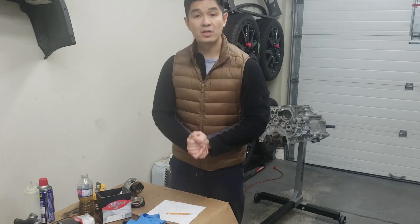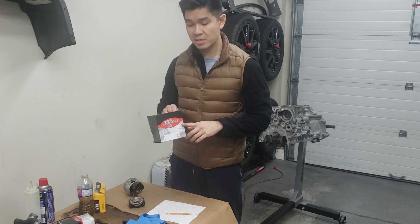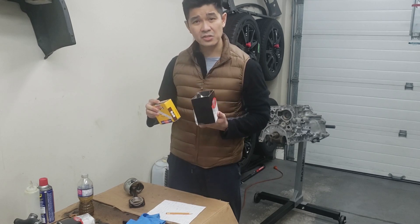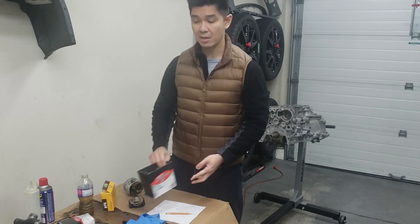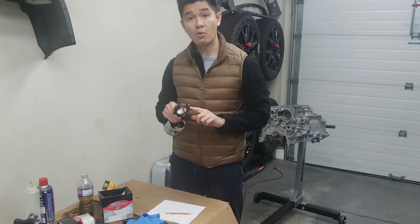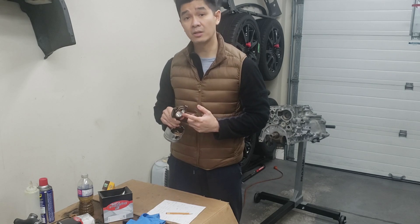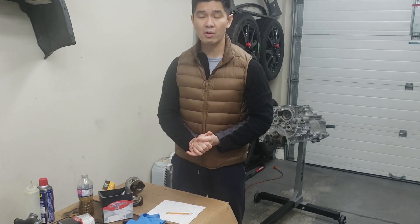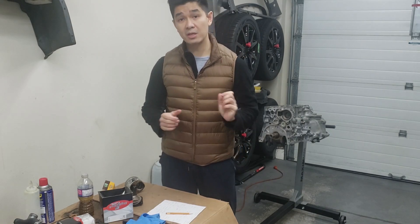I just finished checking the end gaps on all the replacement piston rings from Engine Tech and they're all fine now — very comparable end gaps to the NPR rings. So we could run either the Engine Tech or the NPR, but I think I'm going to go with the NPR because they're made in Japan. I'm also going to run the replacement connecting rod bearings even though the oil hole still doesn't fully line up — it's not completely blocking the hole so it should be fine. Let me know in the comments if you've experienced issues with the bearing not lining up with the oil hole. That's pretty much it for this video — please like, comment, subscribe and share. See you in the next one, cheers.